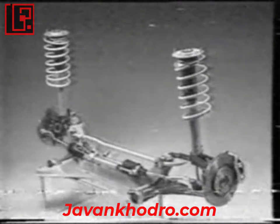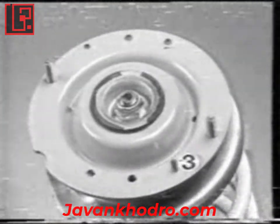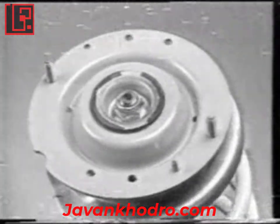The suspension. The front suspension is pseudo McPherson with a lower wishbone, very similar to that of the 305. The lower wishbone rear silent block is of a new type, improving longitudinal feel by a greater ability to absorb road noise caused by rigid surfaces. The front spring and damper assembly can be removed by fitting two restraining cables through the upper thrust cup and hooking them to the lower cup. A locating lug is welded to the upper cup for identification of the caster angle: reference 3 for injection engines, reference 2 for others.